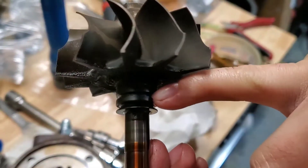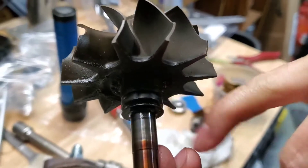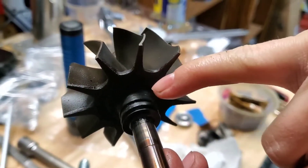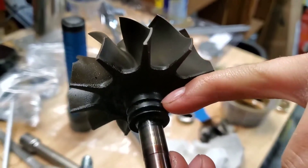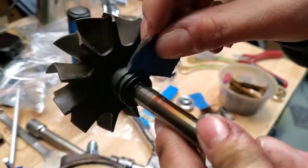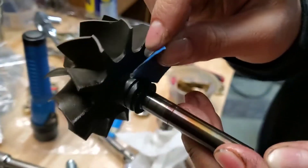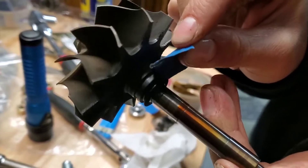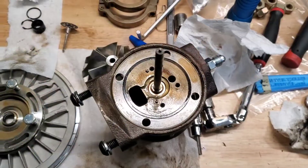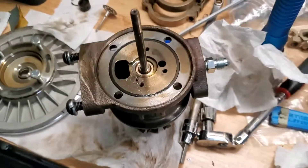You may not know to check the piston ring land on the actual turbine itself, but you'll get a lot of buildup there from the back of the turbo and the other plate, and it'll actually sneak under and separate the ring land. Just get in here with around 600 to 1000 grit sandpaper and polish it up a little bit — nothing crazy. This will get the deposits out for a better seal. Then pop the new piston ring back on the turbine side.